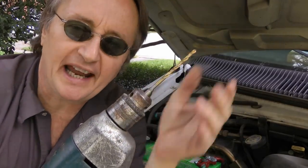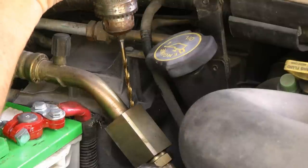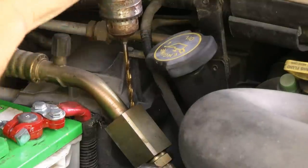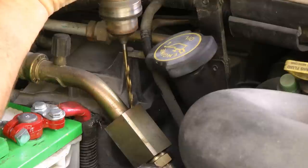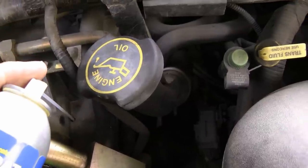So in this case, you get a drill with a 1/8-inch drill bit and very carefully drill a small hole. You don't want to knock a hole in the evaporator, so just make it a short distance. And as you can see, the spray goes right in — now that can clean it.